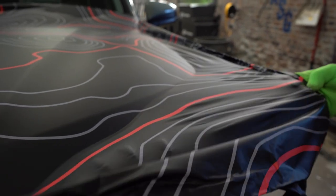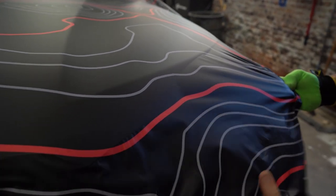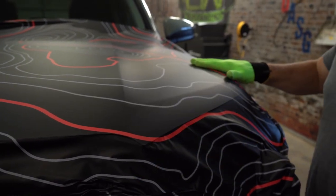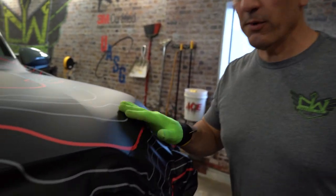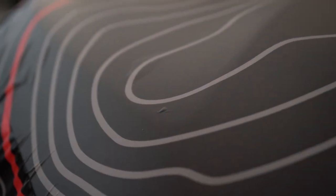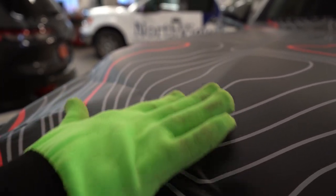You're going to take your hood corner and give it just a nice little pull, bring it right around that edge, and work it down — not overly pulling. Spread it out a little bit and come right around that edge. That corner is all clean, it's done. It looks good — no bunching. Another one of those little bubbles wants to run in an air channel right there. You're better off right away to either poke it or lift it. If you sit there and try to work it, it's going to make a little air channel run and you'll have lines in your wrap — and you don't want lines.